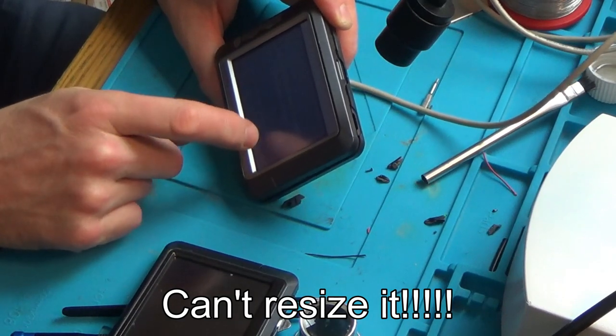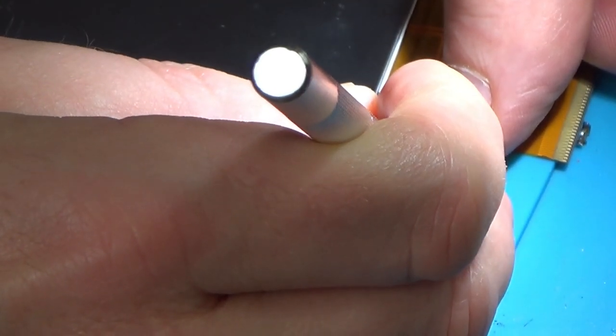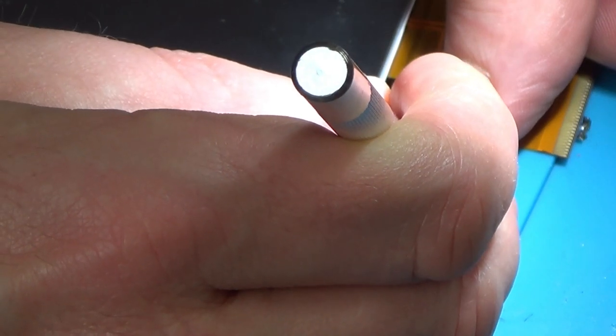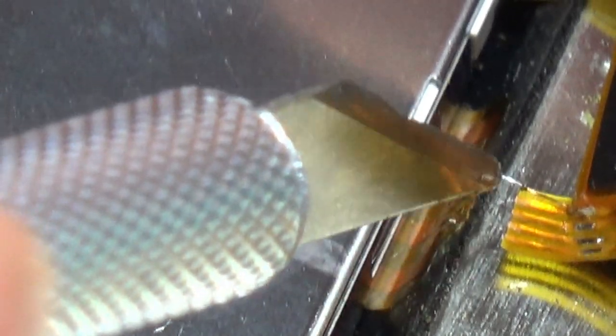Oh, that's why the touch screen is not working - can you see the ribbon cable is broken here? Look at that - the ribbon cable is broken. Well, that's why the touch screen is not doing what it needs to do. It's a shame that this one doesn't fit. Now any of the other ones are going to fit? No, they're all bigger. Let me try and repair this, I suppose. So I'm just using a blade to scrape back the ribbon cable to get to the copper in the middle of it. I can see shiny copper on all those little bits now. So we have to get the soldering iron and try to add some solder to those bits. This is going to be extremely hard to see, but you can just about make out a pad here with a wire going up to a pad here. I've done one, I just need to do the other three - then we can see if it works. This is probably going to take me about another 15 or 20 minutes, so I'm going to stop filming for a bit.